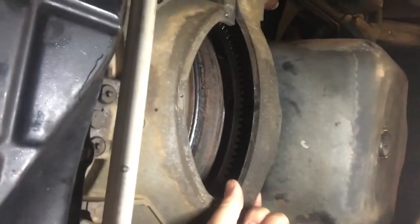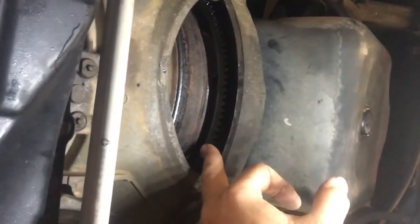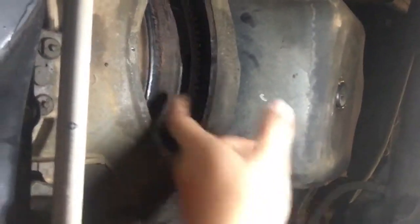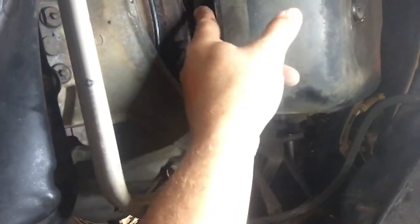...in the adapter plate on the 68RFE — it's got four bolts on each side — and my main top left bolt, from what I'm seeing with a scope, is my culprit. It's backed out probably a quarter of an inch, it's touching all the torque converter bolt heads back in there, and it's actually rubbing the flex plate itself.